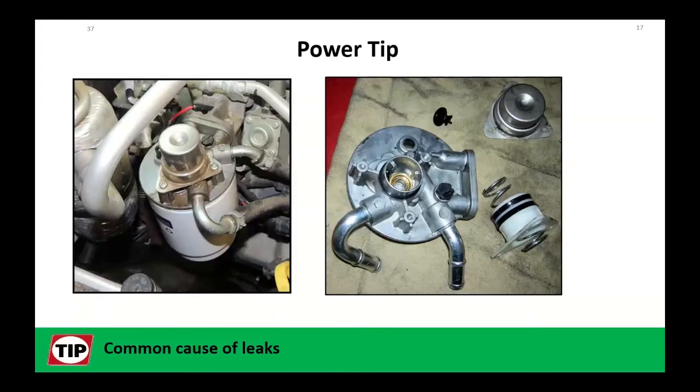Talking about the pump, the fuel filter assembly we discussed before sits underneath the hood of the vehicle, filters on the bottom. That's coming up, that's going out to the rail and everything. This is your pump, that's your manual pump. When you change the fuel filter, you can unscrew that and put a new one in. Some people partially fill the new filter with good clean diesel fuel. That's okay. But then you've got to pump this thing until it doesn't pump anymore. It'll eventually quit going down. It'll be hard as a rock. That's going to put about 10 PSI to the high pressure pump.